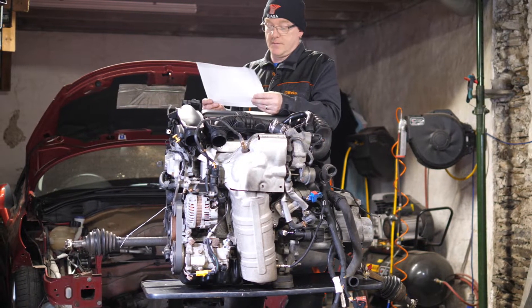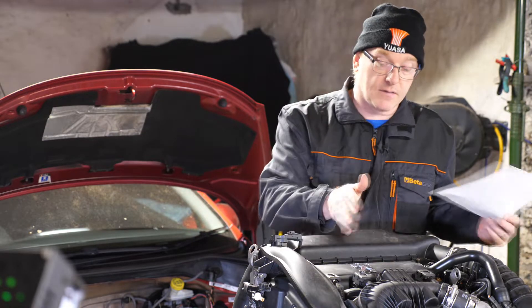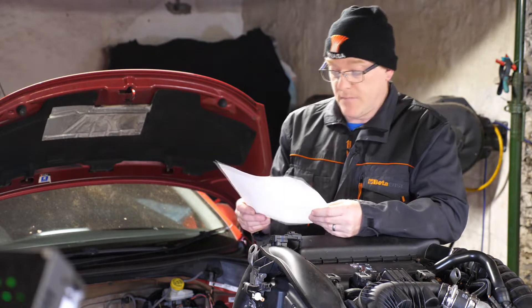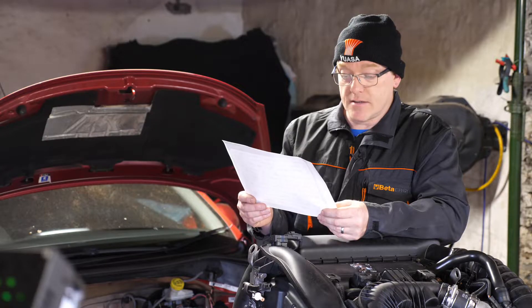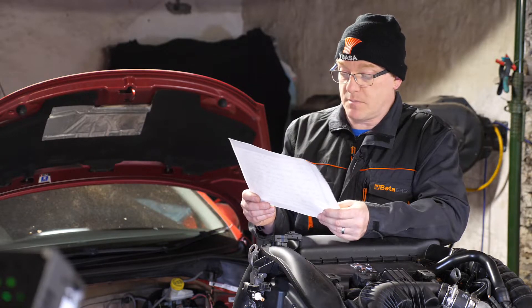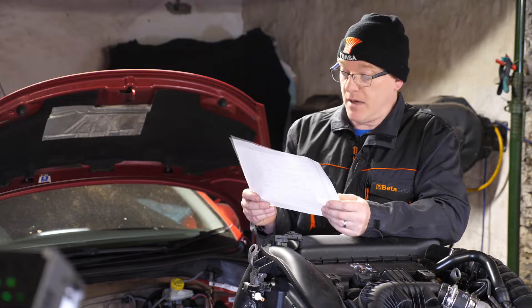All the dash lights went out each time I turned the starter on, like it was too much load, and the engine seemed to be locked. I had a quick look to find out what was going on — I took a spark plug out and noticed there was water in number four cylinder. Spark plug number three was smashed, the thread was damaged, and the valve springs were stuck down in place.